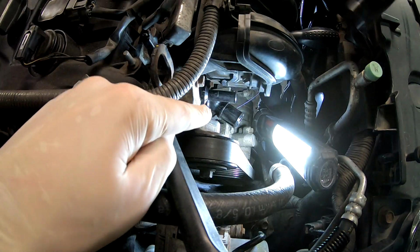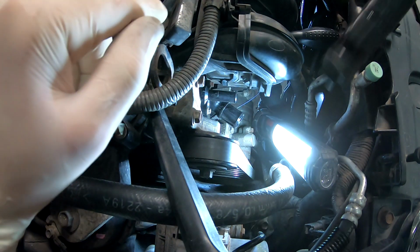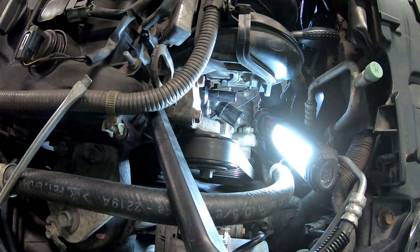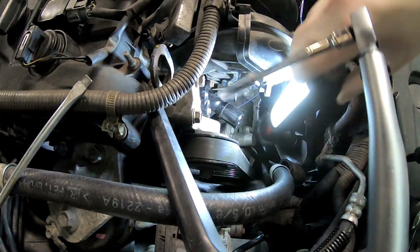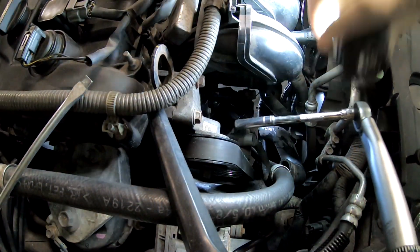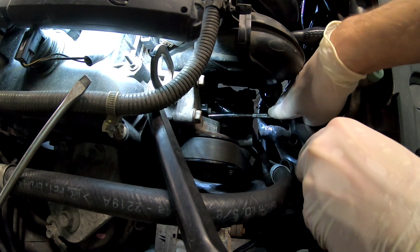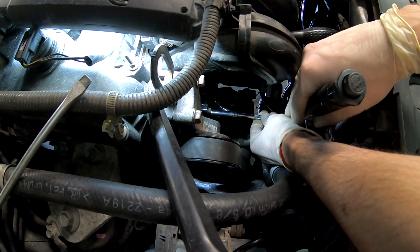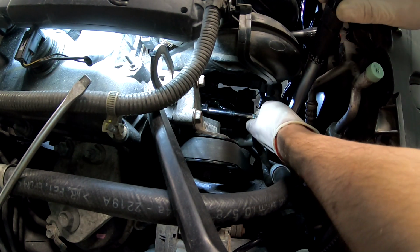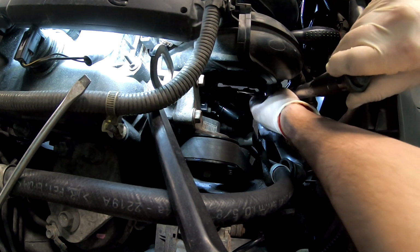So torque specs for these 3 bolts is 6 Newton meters or 4.6 foot-pounds. So I'm using 6 Newton meters. In our language, tight, just snug. Sorry, I know you will be able to barely see it, but it's in my way. That's done.